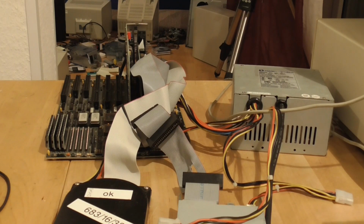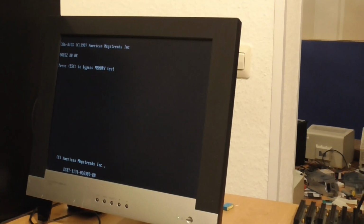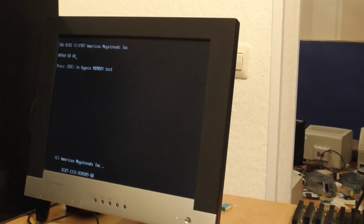Well, I certainly hear a hard drive powering up. That's a good start. Unfortunately, yep, I'm actually getting a picture on the monitor. Check this out, guys. Look at that. It's booting. Unbelievable. Wow, so it's just that capacitor that was dead, and apparently I didn't break anything else in the meantime, so that's great news. Alright, so we apparently have a board that's working.